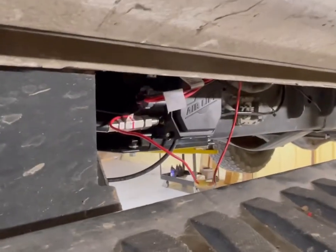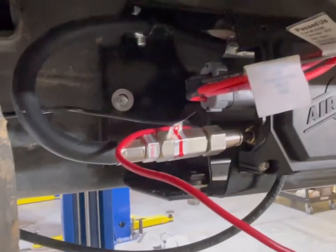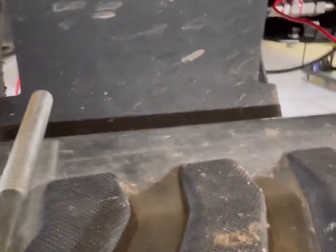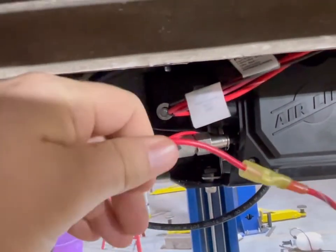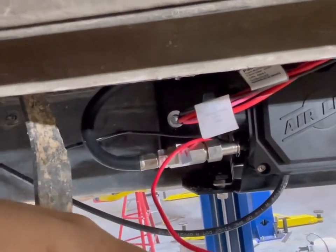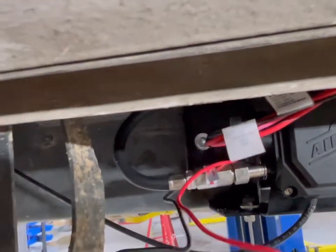All right, here's kind of the finished product underneath — semi-finished. Just got to tie up all the wires, zip tie everything up and finish. On this one, it was easiest to actually do self-tapping screws into the frame. You can use this big U-bolt, but this frame was a little bit too big for it. You can also drill holes with a bolt style — there's three different ways you can do it, but we just did self-tapping on the frame. You'll cut that little crimp end off, and then you'll splice it into this one here — red on red with that white wire. The ground will be back here; you'll ground it somewhere right here to the steel frame.